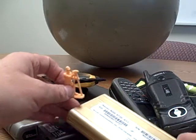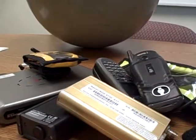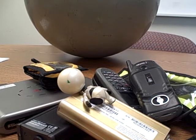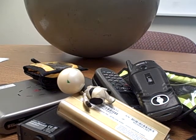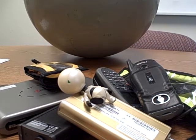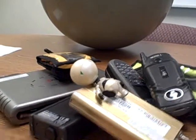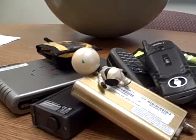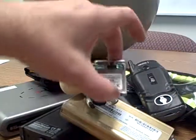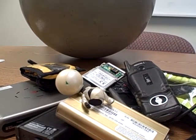When you go to set up your data collector, you'll need to configure modem settings. When you have something like Microsoft Mobile or Windows CE, you go into Control Panel, Network Settings, and add a modem — in some cases it's listed as 'Add Hayes-compatible Modem' — and then go through the steps. Something you'll need from your cell provider up front is a dialing code. Your ITN operators are not versed on every account out there, so don't bug them too much. The cell provider needs to give you this dialing code — it's not really a phone number. For instance, on Nextel over most of the country, it's S equals 2, which you put in instead of a phone number.